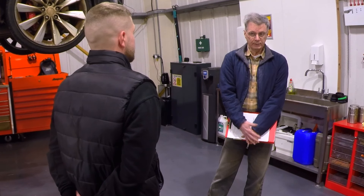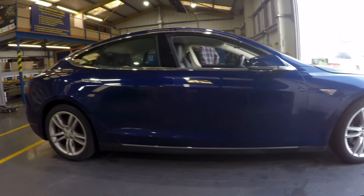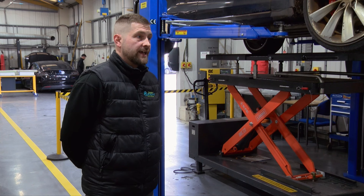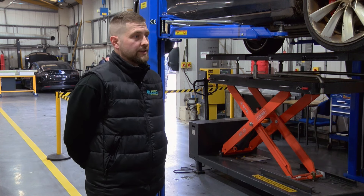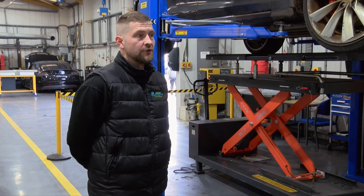When you reassemble the high voltage Tesla batteries, apart from pressure testing, do you use special sealants or tools? Yes, we use a proper body sealant designed for sticking panels together that's waterproof. For tooling, we've got some very low-pressure gauges and we follow the Tesla routine to the letter for pressure testing, leaving it for quite some period to confirm there's no leak-down. We pressure test the cooling systems as well before the lids go back on.